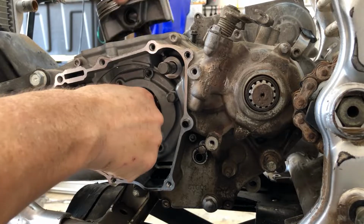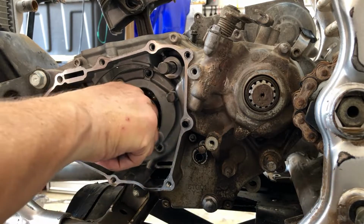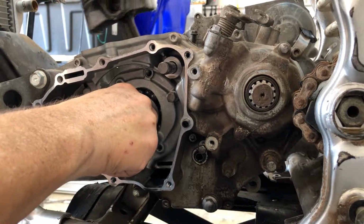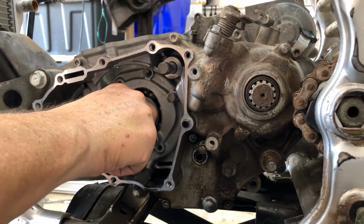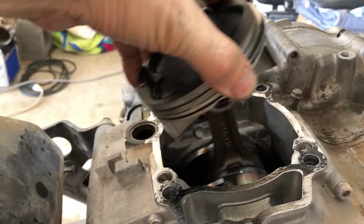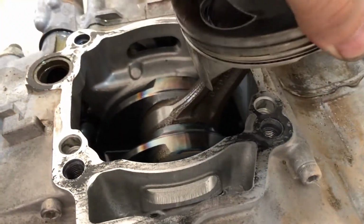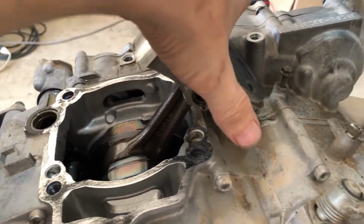Ooh. Oh yeah. It is definitely the crank bearings. The crank itself. So it just bound up on itself. When I came back around, it caught right there. Oh yeah, they are. You can hear it. They're making grinding noises, so that'll be that. So yeah, bound up on itself right in there. And you can see, it looks kind of burnt. And when I'm cranking this thing too, you can just smell the burnt oil. So yeah, it spun the bearings for sure, man.